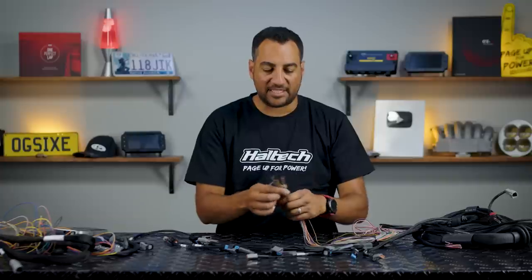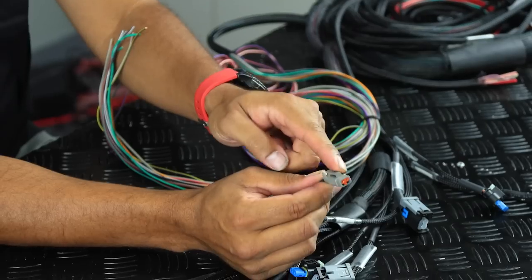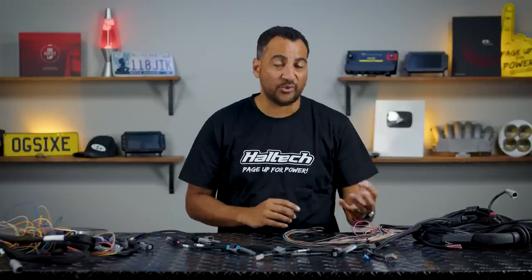You can see how important it is to think ahead and come up with creative things that may need to happen in the future. Having bare wires out in the engine bay is probably not what I would suggest — I would always put a connector on it, no matter what connector it is, just so they are safe and insulated. I always use the female pin side of the Deutsch connector so that it can't physically short out on anything like a bolt. Always use this side with the wedge that's closed off, as the pins are all completely insulated. And use the software so that you can find out what you can and can't do, so you don't get caught out trying to run a wire that doesn't do a function that you thought it might.